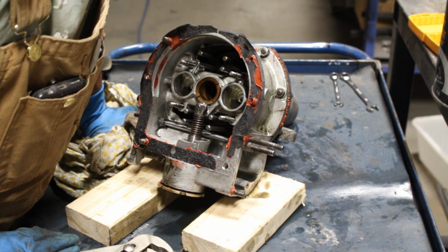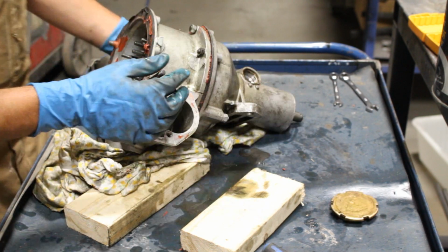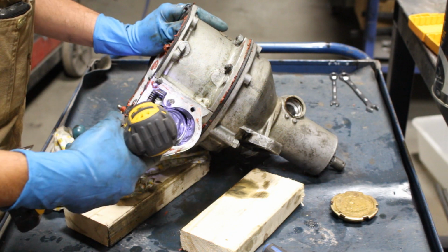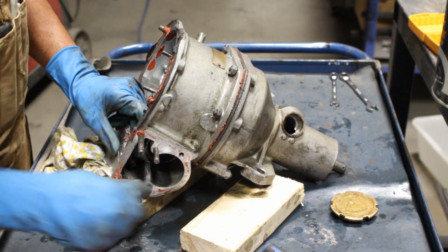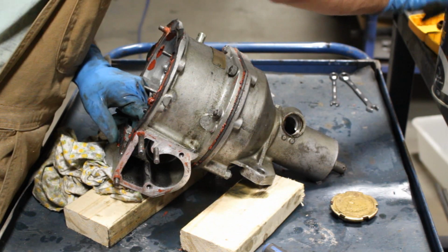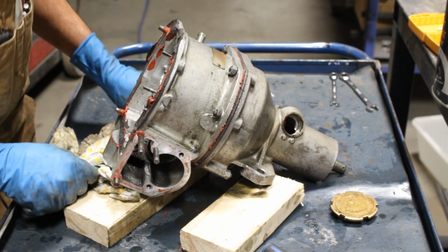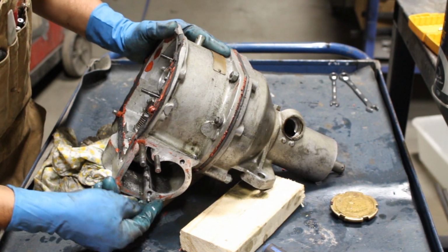Okay, what's next? Remove the pump. First remove the check valve plug, and then the spring, and then the plunger and ball. So it's similar to the operating valve. So we're gonna remove that first. Okay. Come on, let go. So this is the plug. I'm gonna put it here. There's a spring and a plunger. There must also be a ball inside. So let's see if this ball is gonna come out. Yep, this is the ball.